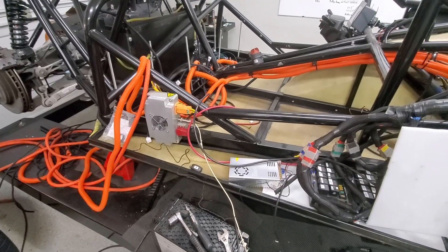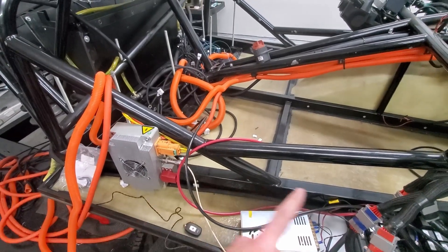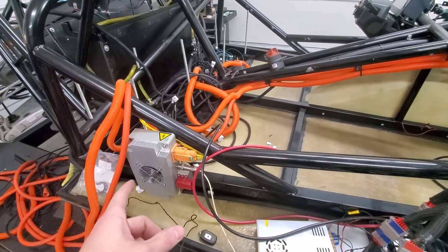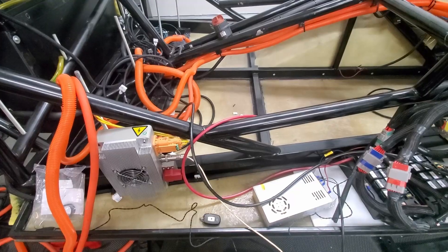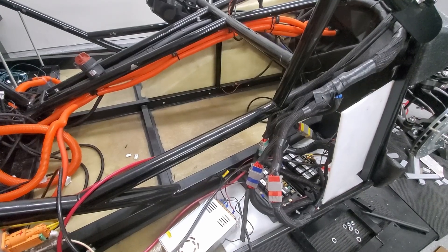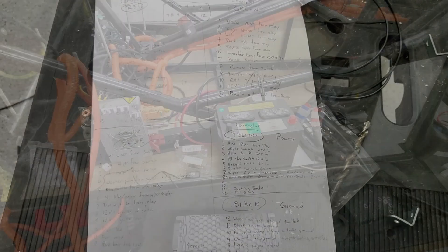I've been diving into the 12-volt systems for the DC-to-DC converter. This cable needs a fused, switched 12-volt signal so that when the car is on it will be converting 400 volts — or around 350 volts — to 12 volts. If you think it should be on all the time, let me know and I'll switch it to always-on instead of switched. I'm going back to my old wiring diagrams to find the right wire — pins 9 and 10 are both blank, so I'll tap into the yellow plug to get that wire.